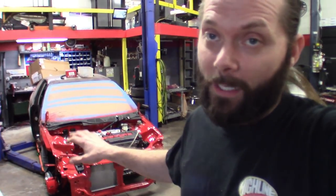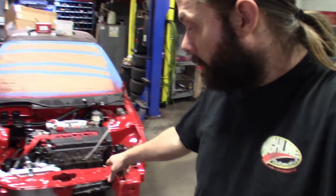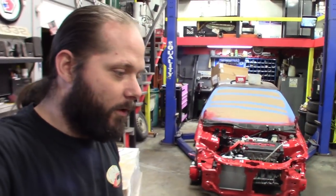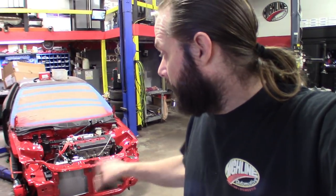Had to get one out there for you guys, had to show you how the civic's looking right now — I think it's coming together. Got more of the parts that came in this week, still waiting on the injectors, still haven't ordered a turbo kit yet. Probably not going to go with an eBay turbo kit — I'd like to get everything set up as far as wiring first. I got the oil feed in, still got to drill the pan for the drain back, getting everything set up for any universal turbo I choose, whether from eBay or Go Auto Works.